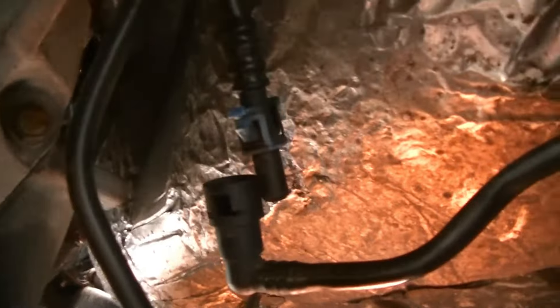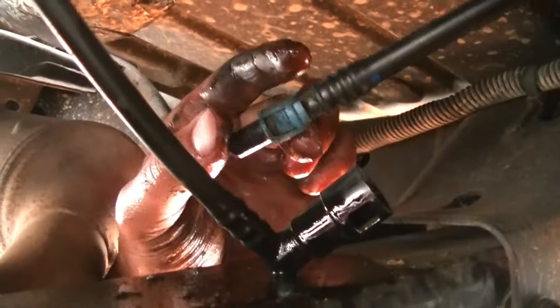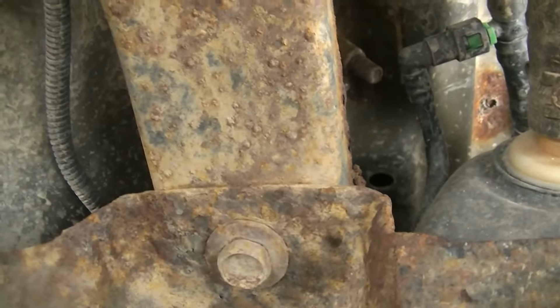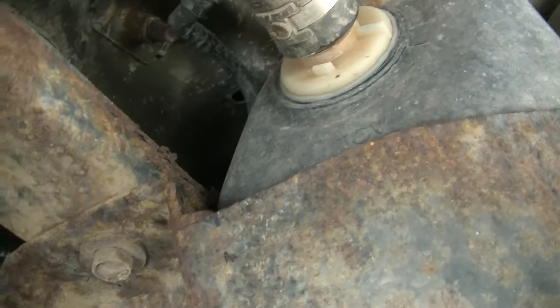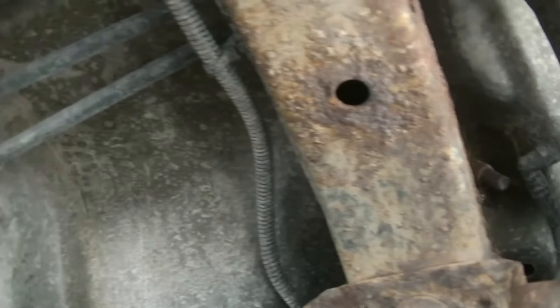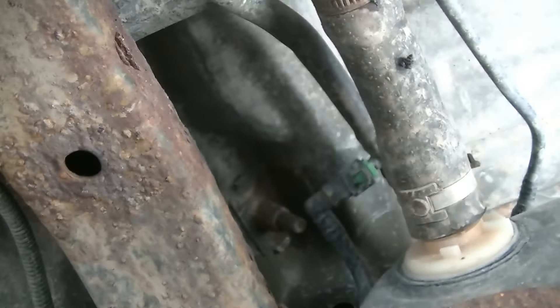You're going to have two lines up front here — one is going to be a vapor line, the other is going to be a fuel line, so do be mindful of that. We did get a little bit of gasoline on us, but it is what it is. Now we're going to start working our way back — you can see all the holes in this thing. We're going to start disconnecting our filler neck up here. It looks like there's another line that goes to the canister we'll have to deal with. The fuel pump is back in this area and we're going to see if we can reach the electrical connector before we lower the tank.